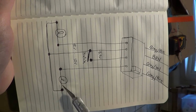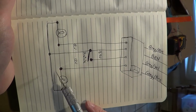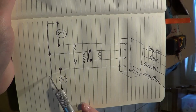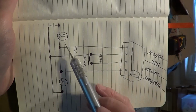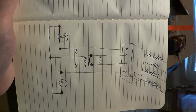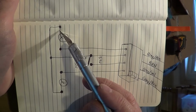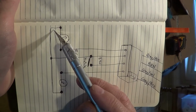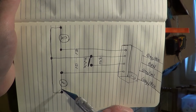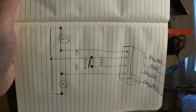And in my case, the problem was this is a printed circuit board in the assembly, and there was a bad connection here, is intermittent. But this bulb was still working, so the ground return was still coming to this bulb. And so what I ended up doing was just soldering a wire here at this bulb, at the socket, and routing it through the entire assembly over to here, soldering onto that part of the socket. So it restored the return ground.